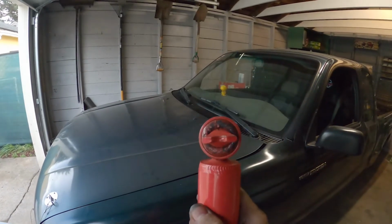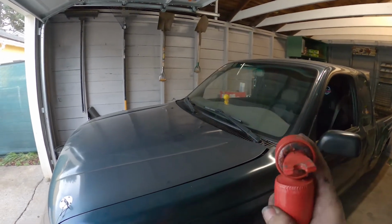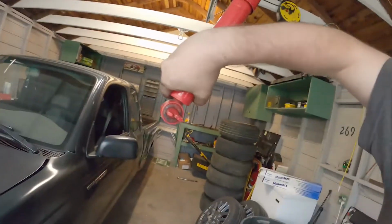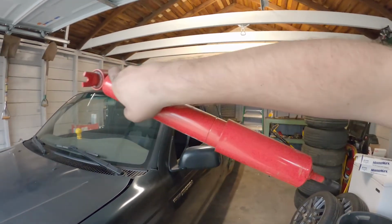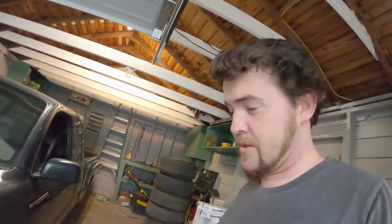And on top of that, when you try to jack the arm up, this thing stays absolutely flat and refuses to allow you to rock it or rotate it to line it up with the bolts, which are on an uneven plane when that thing sits in there. As the shock sits like that, and that control arm sits like that, try to do that, it's just not going in there. So I had to put the white one back in there. Remember I said red junk or white junk? It's all junk. Just use what works.